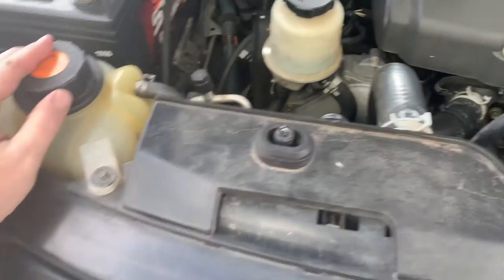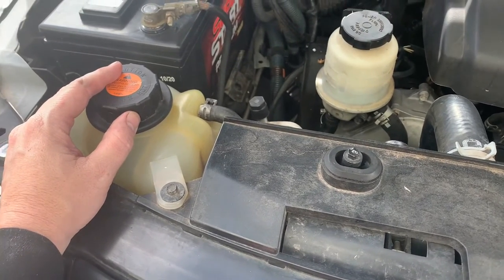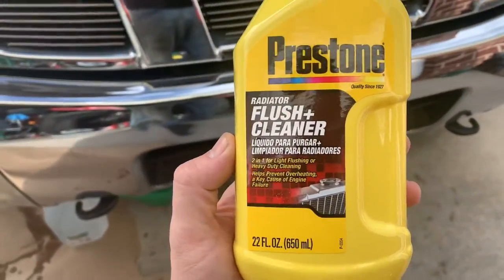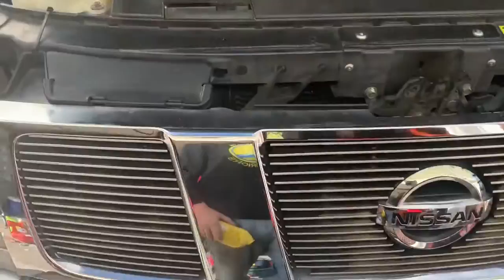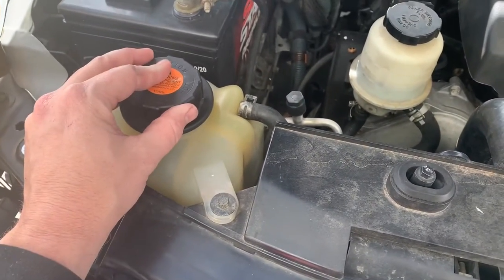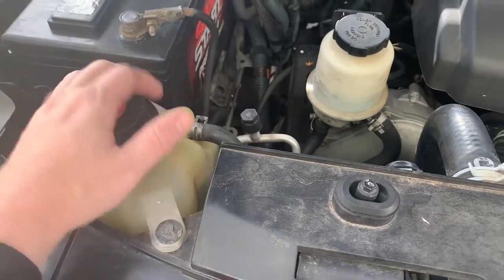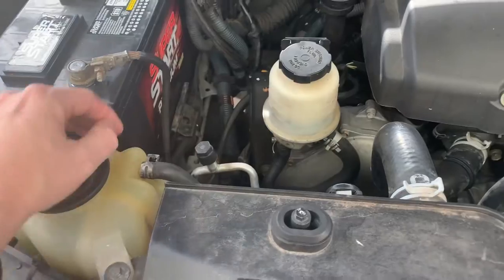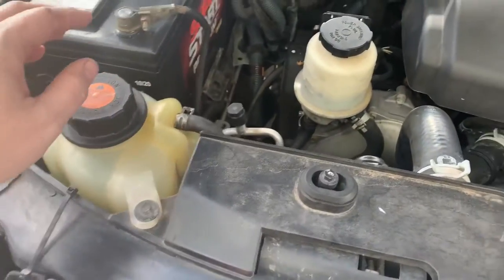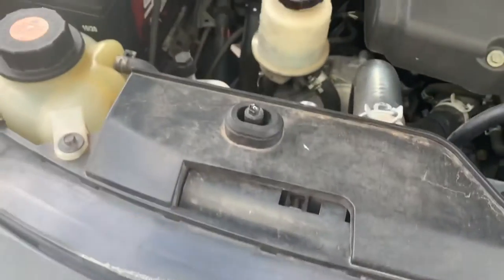It's the next morning. We have driven about five hours with the flush and fill radiator cleaner in here with distilled water. We're going to go ahead and drain that out and fill it with fresh distilled water, then run the engine for about 10 minutes with the heater on to get everything cycled through the engine and the heater core. Then we'll drain that again. We're going to open up our radiator cap and our overflow tank and the bottom, just like before.